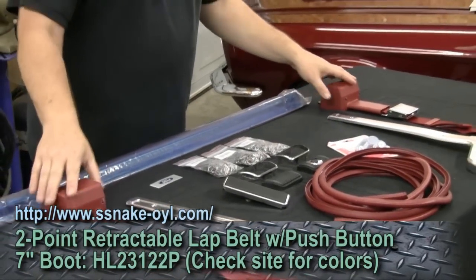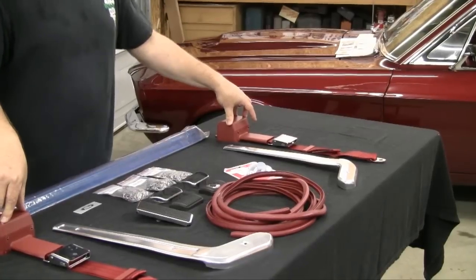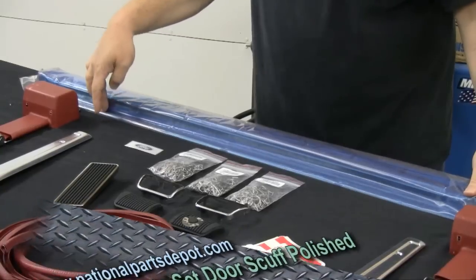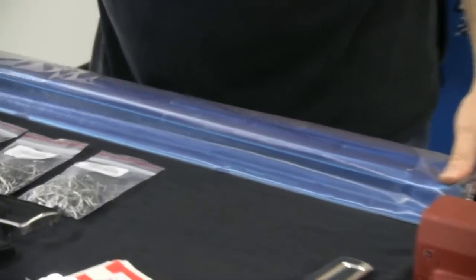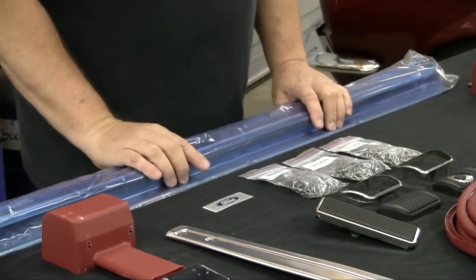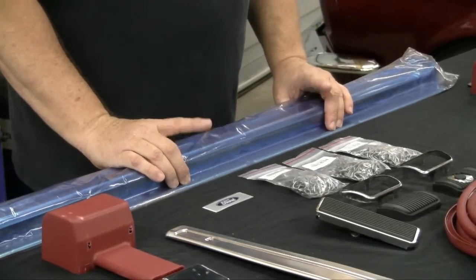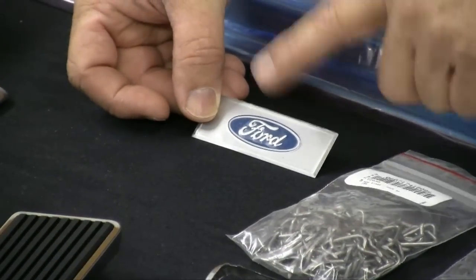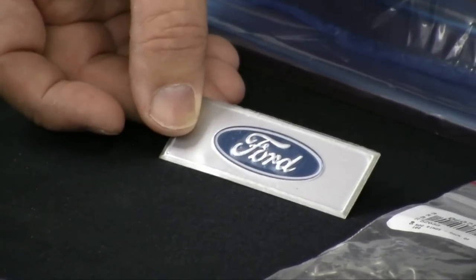The other things we've got here are seat belts from the guys at Snake Oil. Larry's going to go into this a little bit more, but these are really nice looking seat belts that actually match the interior color of the car pretty well. Now in the back I have a sill plate — I accidentally ordered the wrong one. I got the convertible sill plate as opposed to the Fastback hardtop sill plate. There's an L bend at the bottom for the inner rocker on the Ford convertible, and that's not correct. These are stainless sill plates, and if they're available for your car I'd recommend getting stainless over aluminum. When you order your sill plates, do yourself a favor and get the logo — Fisher Body, Ford, whatever — because most of the time these are not included with the sill plate itself. So you'll want to order these separately when you order your sill plates.